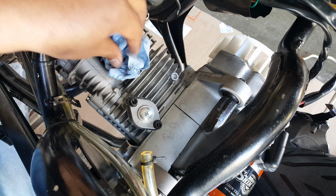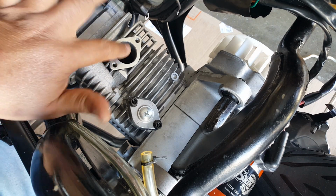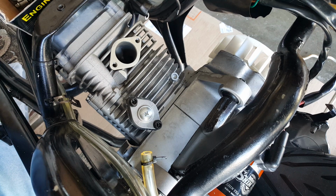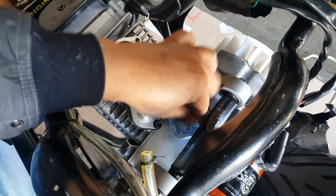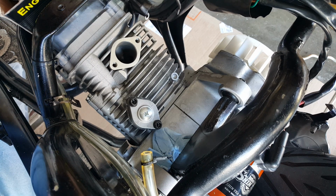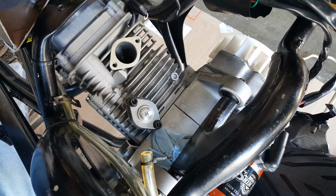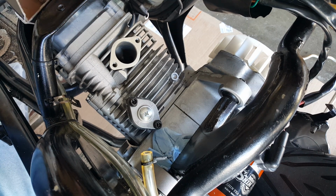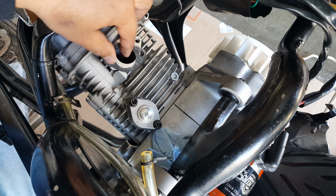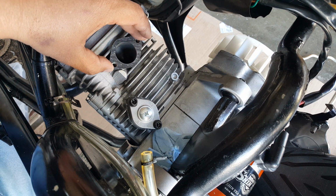Even with oil sometimes I still can't make sure I remove that, of course, because one time I left a little bit in there and I put the intake manifold on. I totally forgot about it. I was like a surgeon forgetting his tools in your chest. So I remember again, it did not fit universally as we thought. It was the cam chain tensioner and the intake gasket. Those are two separate ones, so make sure you align the intake manifold gasket, the one that actually came with the Tata one.